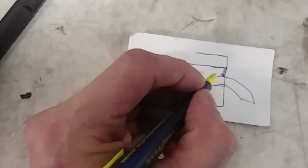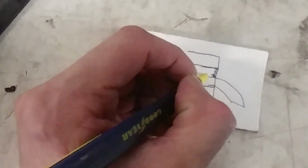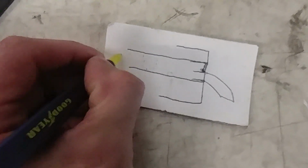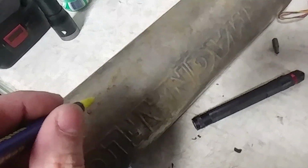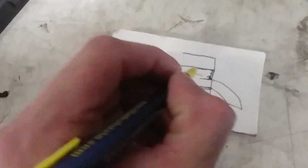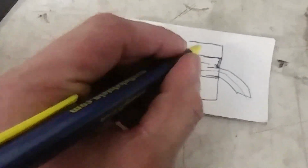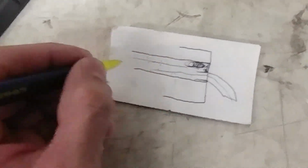Now there's two things wrong with this. One, they should have expanded that pipe. It would have fluttered like that as well. But however, they left this big gap, like so. So exhaust flowing, this is that perforated tube that's supposed to let exhaust gas and noise flow into the packing. But it flowed in, bounced around, some of it got out, but it bounced around here, creating turbulence, causing that fluttering noise.